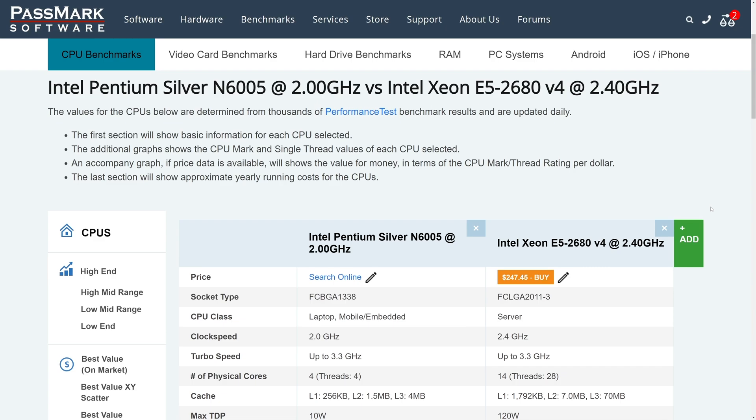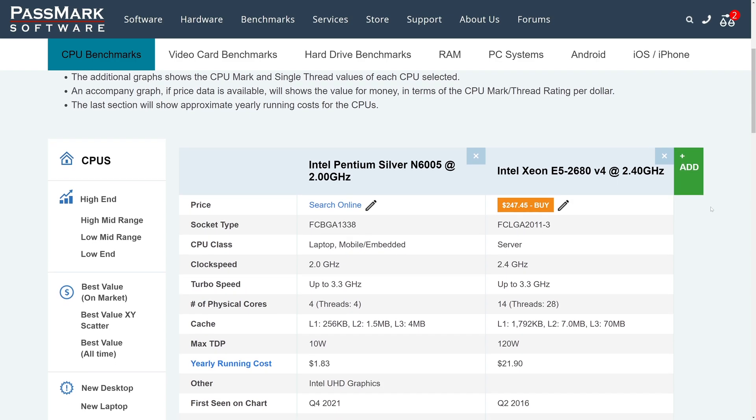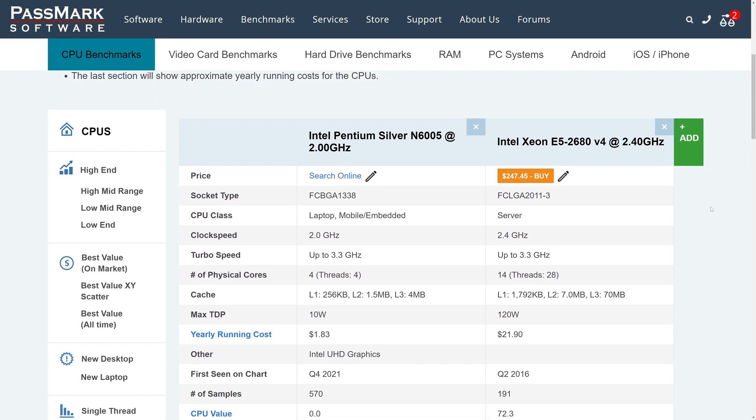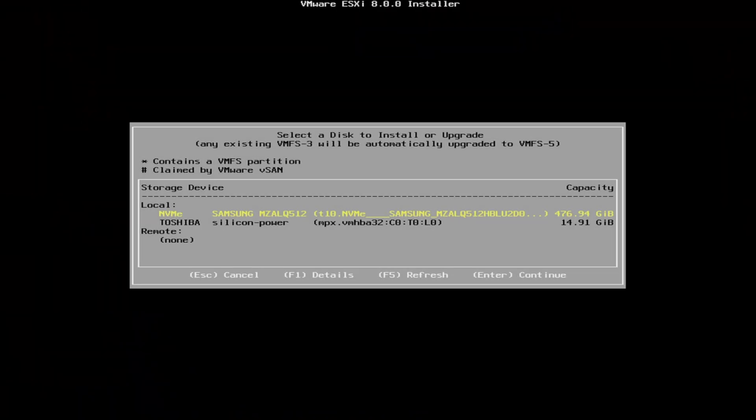This unit doesn't compete with a full stack of enterprise Xeons performance-wise, but for someone looking to get into homelabbing or self-hosting who wants the flexibility to run ESXi for virtualization or bare metal containers without taking up huge space or consuming huge amounts of power, this is a great start. Installation of ESXi was just the same as any other host and completed without any issues. We targeted the newly installed NVMe disk for the ESXi installation, and there were no issues to report.